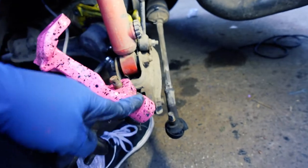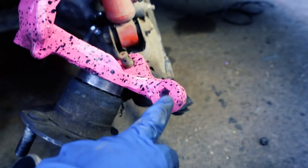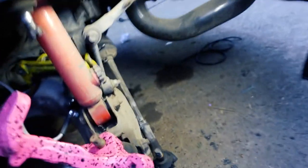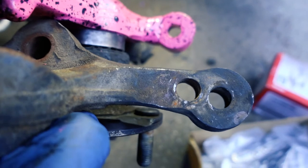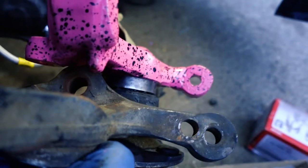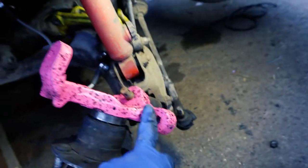So how these knuckles work for those of you that don't know: the closer inside it is, the more it's going to push it out. If you push from right here, you get that much angle. If you push from in here, the same amount of push gets you far more angle. So by cutting and shortening it, you're giving it more angle. Mine was already drilled out, but this one is even more aggressive — so this should be a lot of fun. And it's also safer because you've got it all welded, and it looks cool.